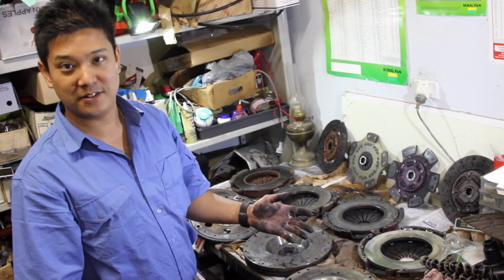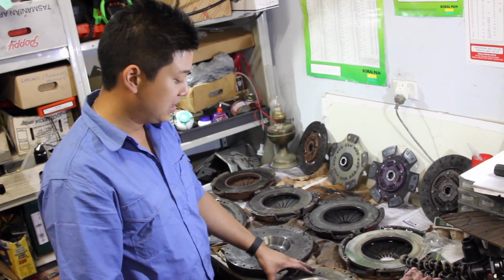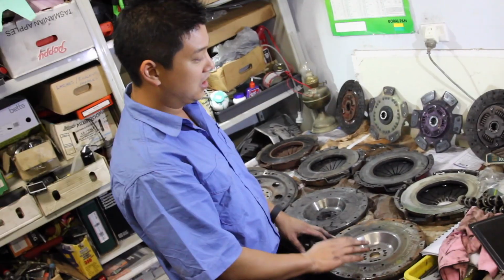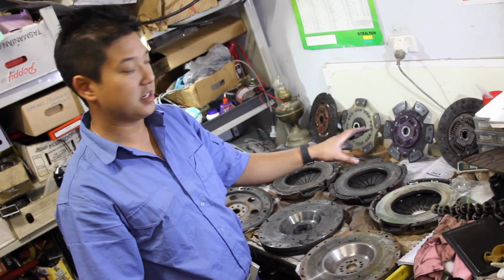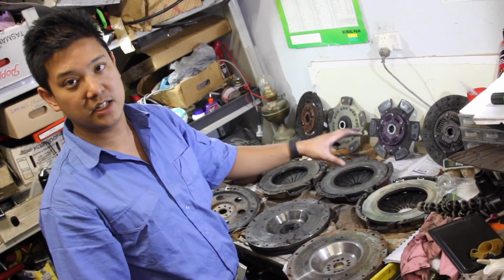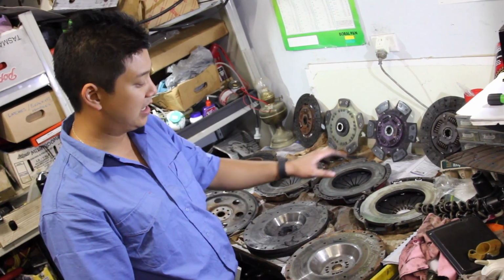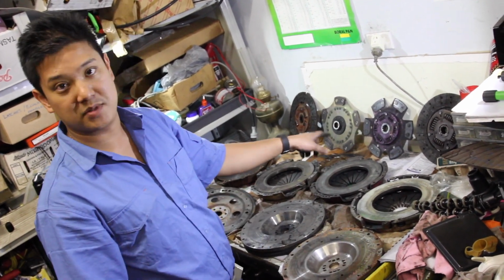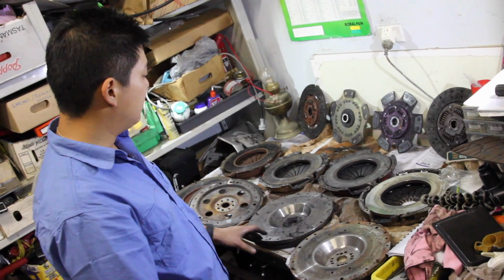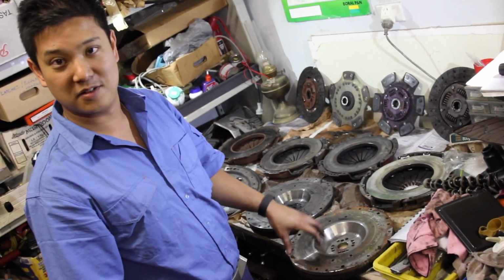which will be something a bit more out of the ordinary than your standard bolt-on or standard off-the-shelf mod L67, and we'll see that when the time comes. And I'll run this clutch with a 10.5-inch, most likely a 6-puck brass button clutch with an upgraded cover, or possibly a twin plate. I'm not sure yet, but most likely a single plate with the same setup, just a bit larger than what I'm running at the moment. Depends how successful this setup is. So there you go. That's my world of clutches at the moment, and I'll keep you posted.